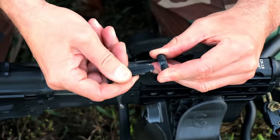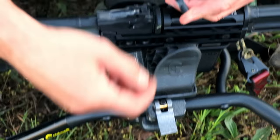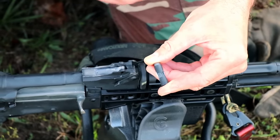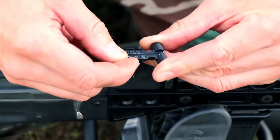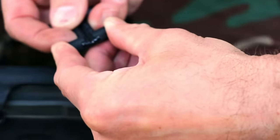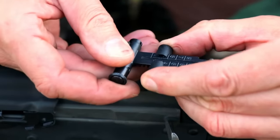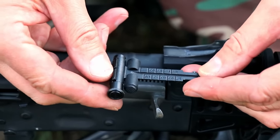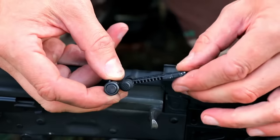From the removed leaf we're just going to extract the drum — those sliders — basically just squeeze them and they will slide out just like that. We can put the old one aside for the future, and I'm going to slide the new one in. You're just going through the slats, pushing forward, squeezing the spring on the side, and there you go. That's the installation for the drum slider.